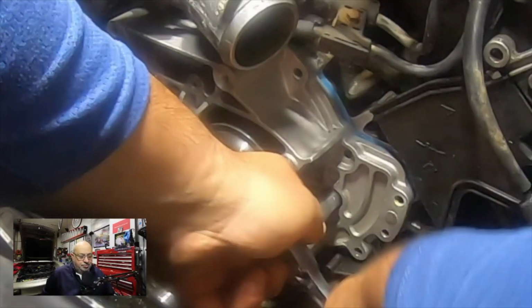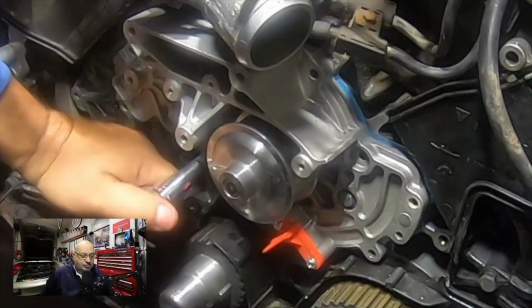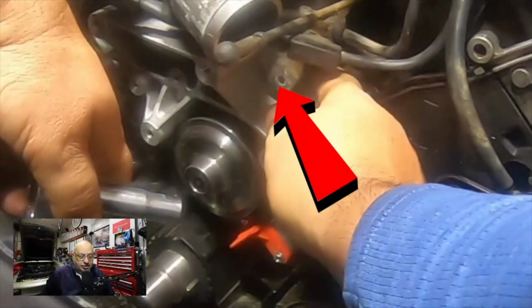the coolant system's working. By putting in that bolt first and the one opposite, we were able to pull the water pump in properly. So you're about to see another problem I had. In the upper right-hand corner of the pump, near where that hose outlet is, there is a spark plug wire bracket that actually attaches to that bolt of the water pump. And as I was tightening this down, that bracket was sandwiched between the pump, and there it is right there. So luckily, I caught that before it was a problem, didn't damage the water pump gasket, and we were able to move on. So just another thing to watch out for is that little bracket, making sure it's on the outside of the pump before you start reefing down on all the other bolts.